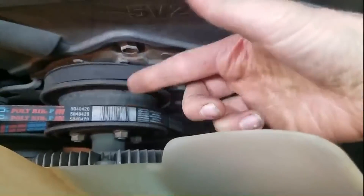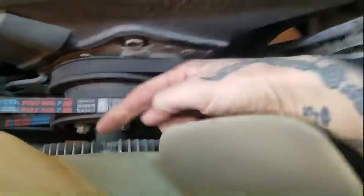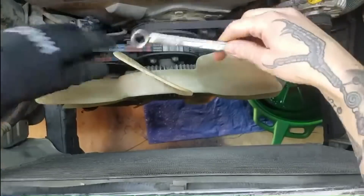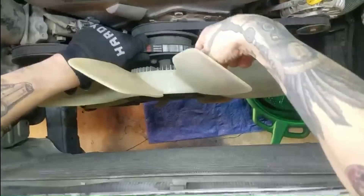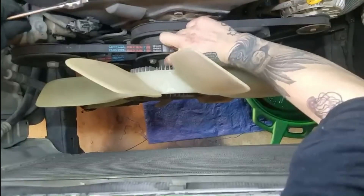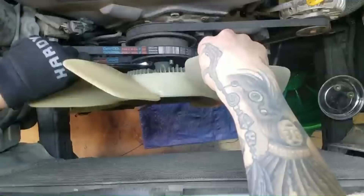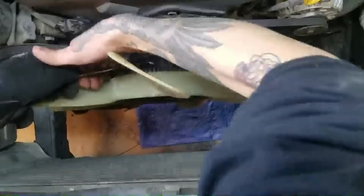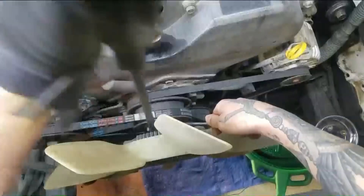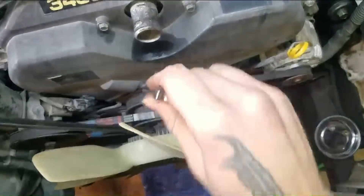You remove the fan with four 12mm nuts. That's not 100% necessary, but the little bit of added resistance that the belts give makes it easier to undo those nuts. Definitely do that. Sometimes you get lucky and these are loose enough that you can just — well, eventually I ran into some trouble, so it was time for my pry bar. There we go.